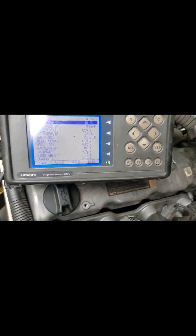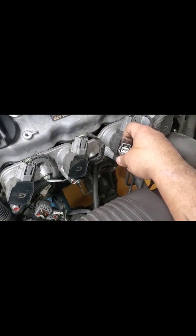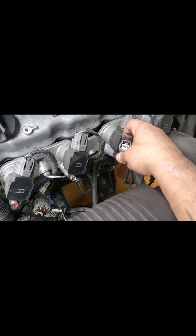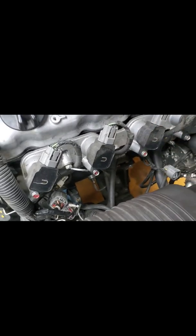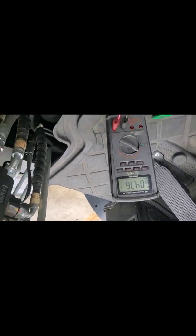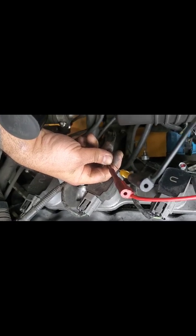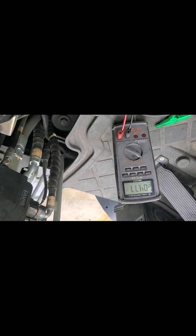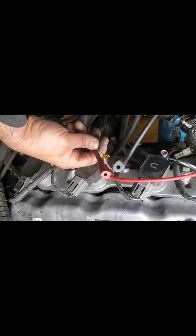What I'm going to do is make sure I have my 5 volts, which is my reference and signal, as well as the ground. I just got my meter in parallel with the circuit, and I'm bringing 4.77 volts. It's a little below 5. I'm not too worried about that.